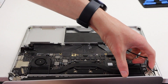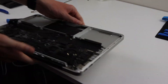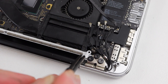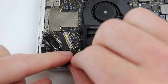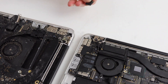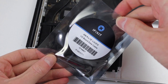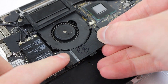Lining our display up with the body of the MacBook, I can put one screw in each side before closing the lid, which will allow me to correctly line the display up with the frame to ensure it's not leaning to one side. Then I can apply some thread locker and fasten all of the screws and brackets, securing everything into place. Applying the little foam pieces on top of the screws, I can begin connecting all of the cables back into place. After connecting the display cable, I'll reconnect the webcam and the three antenna wires going to the Wi-Fi card. I can then use the iFixit replacement interconnect cable to connect the daughterboard to the main logic board of the MacBook Pro.